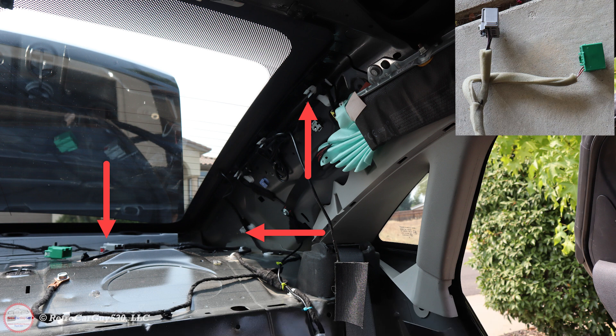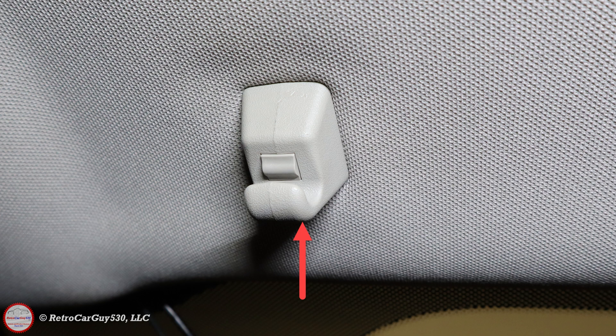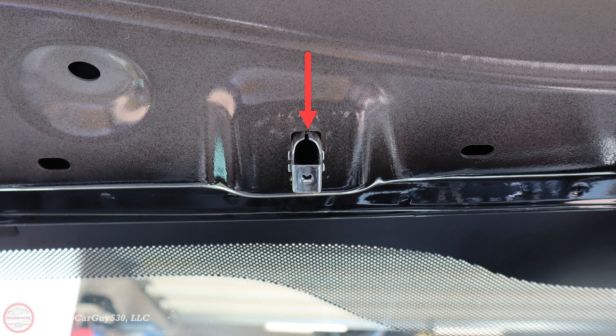On the left rear, the cable comes down and splits off into two electrical connectors on the deck lid — that's why you have to remove the deck lid cover. Make sure you get them routed through the cabling retention clips on the side and drape it down and reconnect them. One thing I learned during installation is that the plastic pin for the sun visor clip won't go in with the plastic clip and the headliner all in place. So pull out the metal clip, put the pin through it, then push it back into the roof — much easier that way.